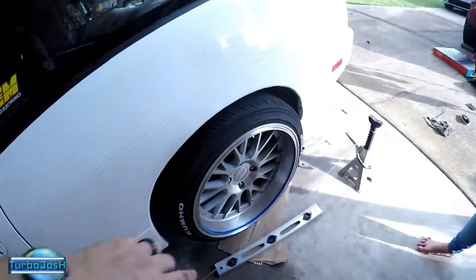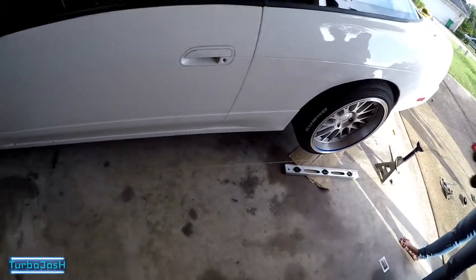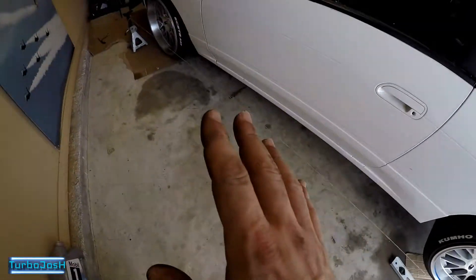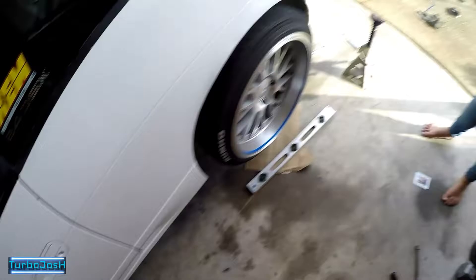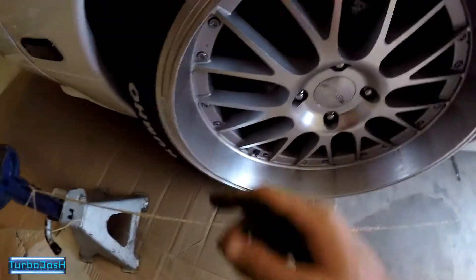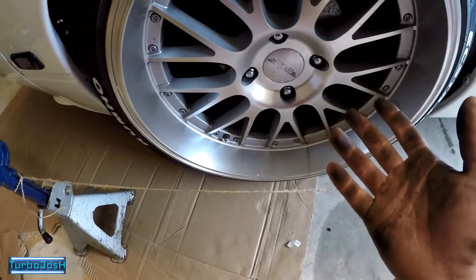I think the back side of this wheel was definitely in about a half inch too far and had the wheel just pointing that way from right there, and it looked ratchet. We have already adjusted this. I'm kind of 50-50 on whether I have this set up right or not, but I know what I'm doing right now is slightly symmetrical and I don't have anything around the house that I can toe plate with and do the slits and the double measuring tapes. So what I did was stretch the cord out throughout the front and back of the car and then I measured my gaps here. My wheels are as straight as I can get them without having actual digital readings from an alignment shop machine.